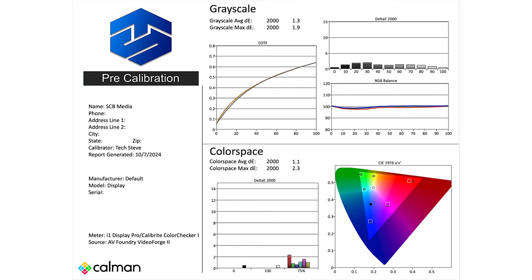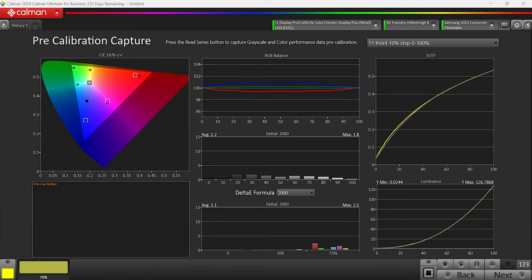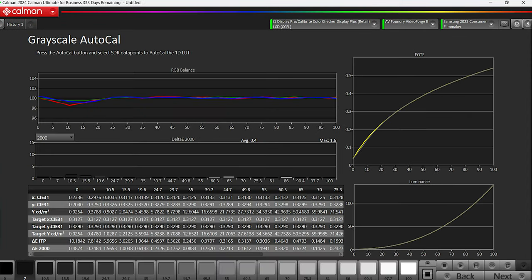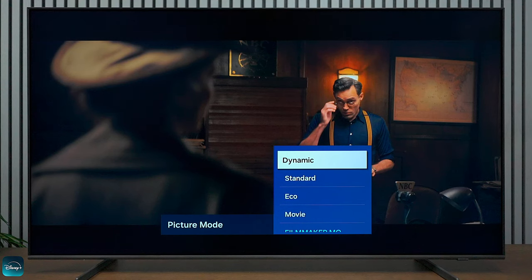I'm not going to be able to calibrate the other sizes. The Q60D out of the box was pretty accurate — I was very impressed with how well the color levels were. But after the calibration was done I was able to get a little bit better picture out of this television. One of the great things about using the CalMAN software is that this TV supports automatic calibration, so you go into the network settings, get the IP address, hook up your pattern generator and computer, and the TV pretty much calibrates itself.